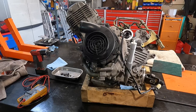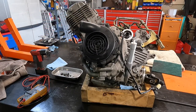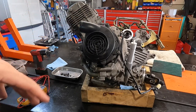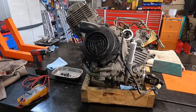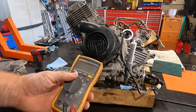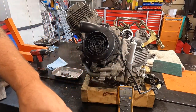Today we're gonna go over how to check the charging system three different ways: checking for ohms on the windings, checking for opens and grounds, and also AC voltage output. I won't be able to do the AC voltage output on this since I don't have the motor running. The simple way to do this is with your multimeter — we'll set that on ohms.